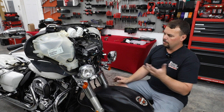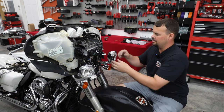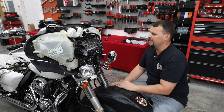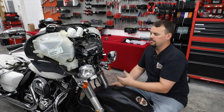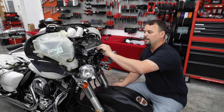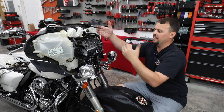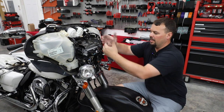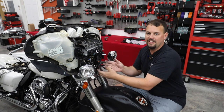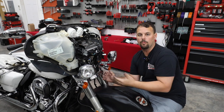All right, so I wanna go over what I've done here. I took the wiring that we had, took any of the excess, and zip tied it up out of the way. We definitely don't want to leave all this wiring just hanging here. Always when I install a Soundstream radio or any radio that uses a thumb control module, we mount that up high. We do that because the inside of this is not waterproof. Water's most likely not going to get to it here, but if we left it hanging, we're going to have water spray up between. We're also going to have anything that gets wet run down and go into it. By leaving it high, there are drip loops, and all the water is running away from it.